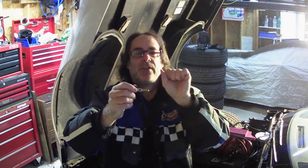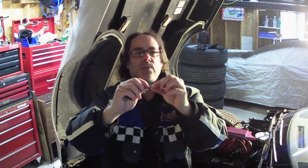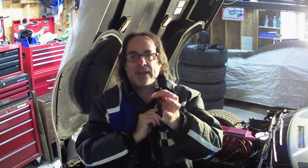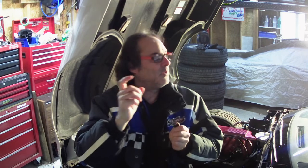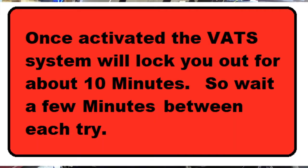So what you'll do is put the key in and turn the ignition to start, and you get absolutely nothing — the lights come on in the dash, but that's it. No clicking, nothing. Your security light should flash when this is not being read properly. First thing you want to do is take out the key, grab a little bit of contact cleaner, and clean off the contacts on the resistor pellet. Then take your contact cleaner, spray a little bit into the ignition, and put the key in and out of the ignition 20 or 30 times. That cleans inside the ignition and cleans this pellet off. Then put it in and give it a try. If all it was is dirty, the car will start.